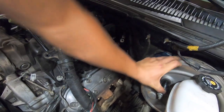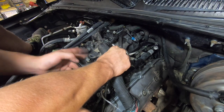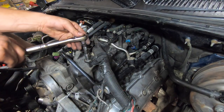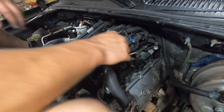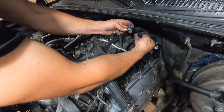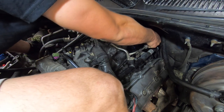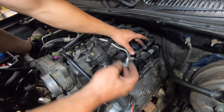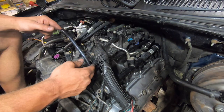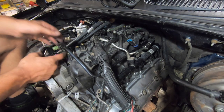I'm going to hook up our brake booster over here. Let's also go ahead and connect our barometric pressure sensor and tighten this down a little bit. Then the wiring harness, our knock sensor connector — very nice. Go ahead and connect our fuel line, put this keeper on our fuel line, reconnect our evap solenoid, put our keeper back in, pop it on, and push it over — so that's locked. We have an electrical connector there that must go to the alternator.